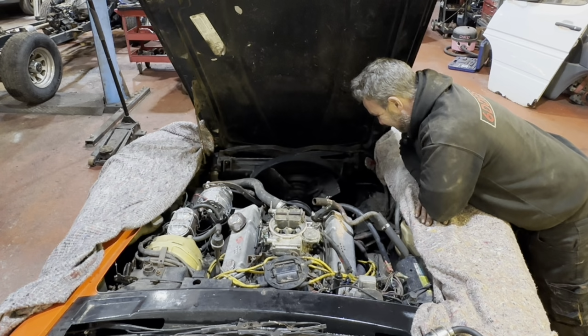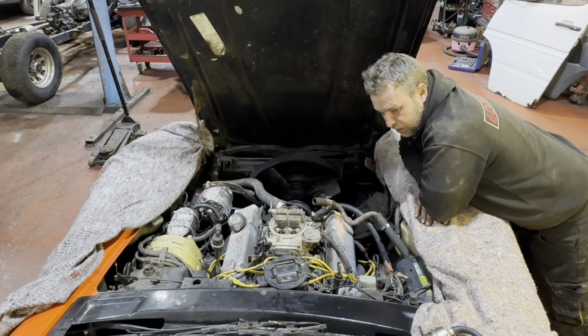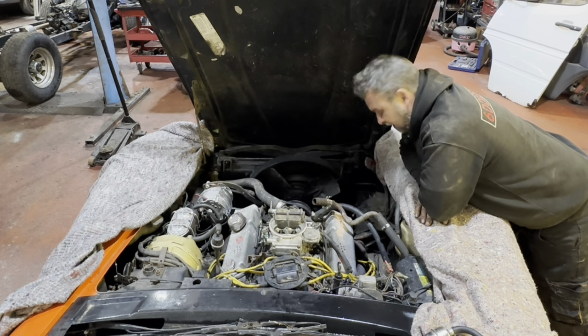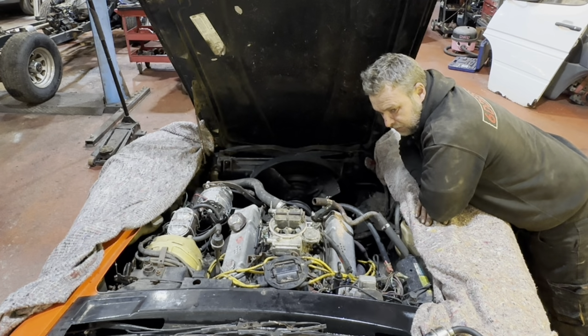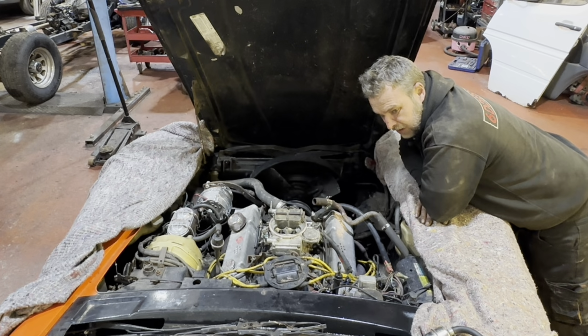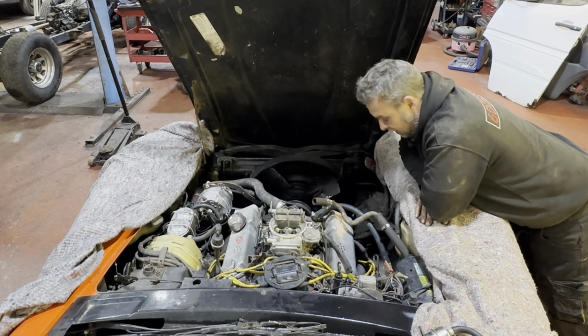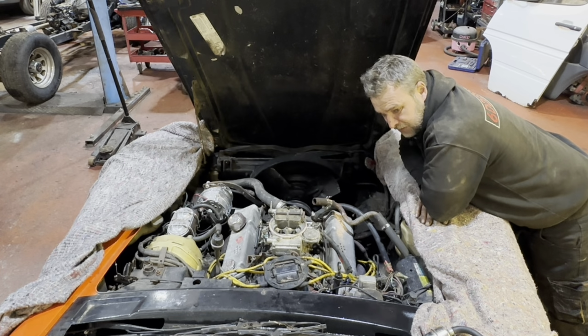Oh, right. So I reckon if I set you on finding a rattler fuel pump, we'll see if there's anything in this tank that we can pump out. Okay, I'll go and sniff on it. What it might be worth doing first, if we assemble an airline and a blowgun, we'll take the fuel cap off after I've had a good sniff, and then blow back through this fuel line and see if it goes gurgle at the back, or if it's absolutely congealed full of snot.